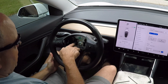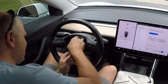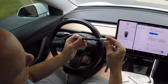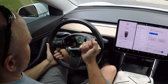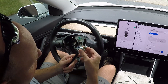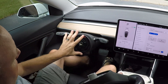Once you're in here, there's another harness you need to remove — that's the harness for all of the steering wheel controls. Go ahead and disconnect that. Now there is a bolt here that is a 10 millimeter Allen. I got this 10 millimeter Allen socket at Harbor Freight. That goes right into the bolt on the steering wheel, and it's pretty tight, so you really have to lean on it to get it loose. We'll set that bolt aside, and now the steering wheel comes off just by wiggling it — wiggle it and pull, and there's the steering wheel removed. And there's the bare steering column.